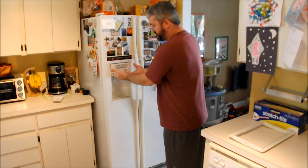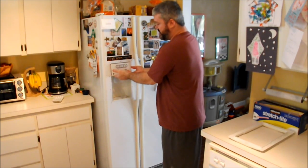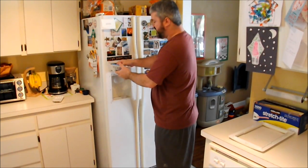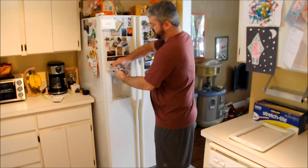The second step is to take off this control panel. If you lift up from the bottom, this should pull right out. You lift up, give it a little bit of a push, and it hinges on the top. Now this is the control panel and it has a lot of wires plugged into it. You want to unplug all these connectors and get it out of the way.